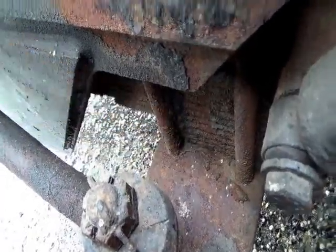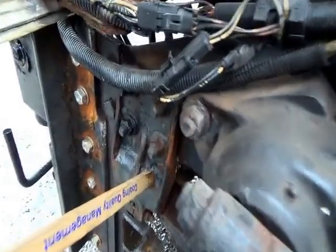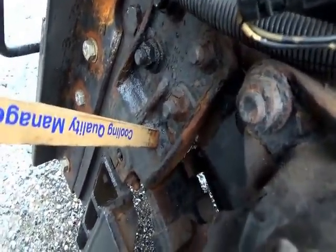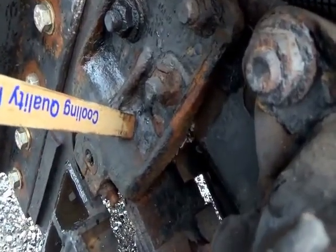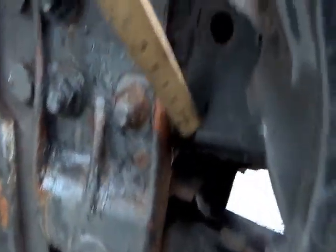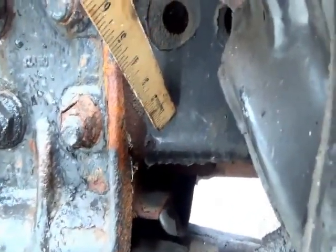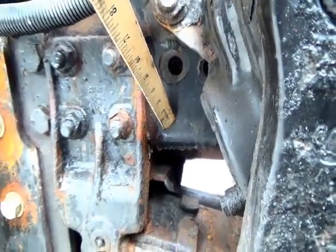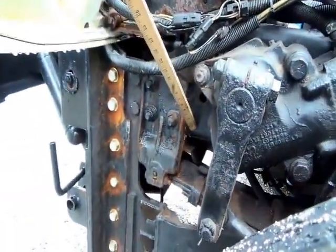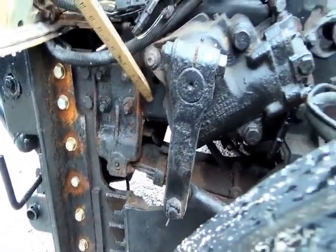And they are held up by the hangers. They are held up by the hangers in the front, right here, and the hangers in the rear. And the hangers are connected to the frame, right here. This is the frame. So when you mention frame, you mention cross members as well. So your hangers, frame, and cross members are not cracked, not broken, and secure. No loose or missing parts, and no illegal welds.